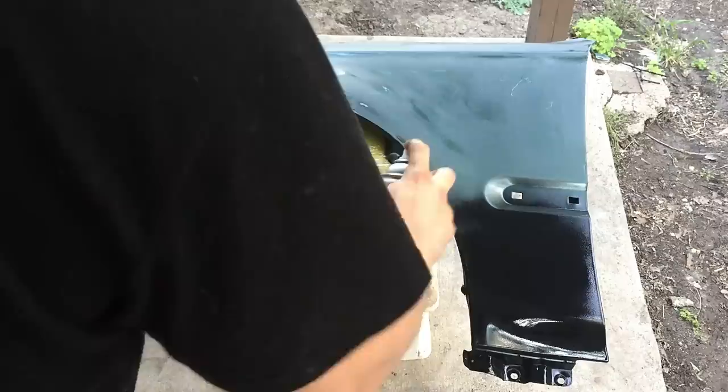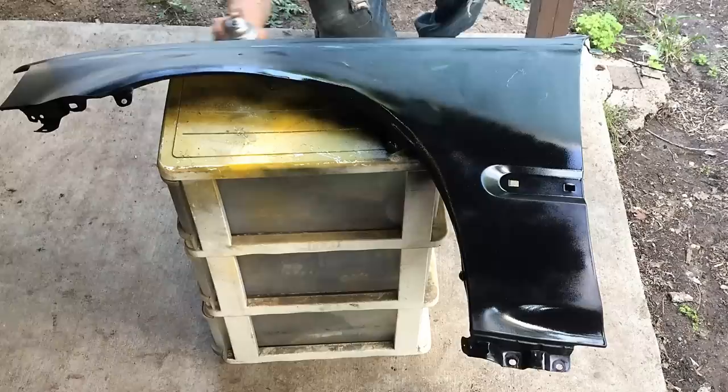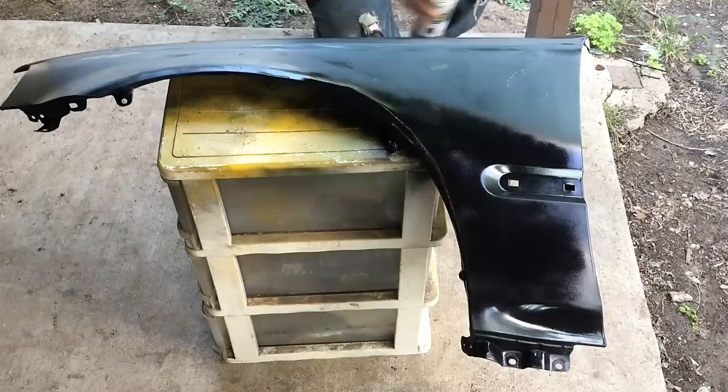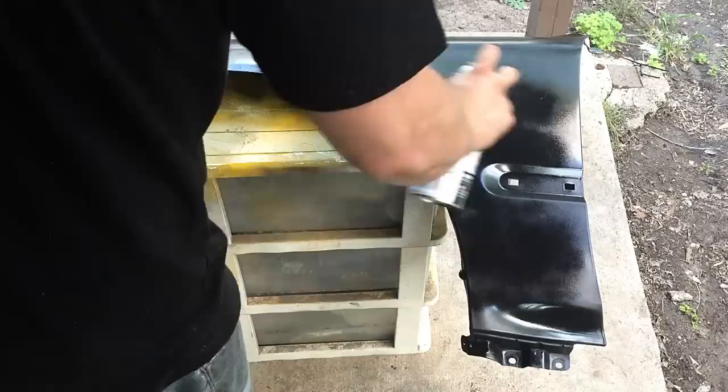This is the sweeping motion I do on my first coat — I lay it kind of lighter. You're not gonna want it to look absolutely perfect on your first coat unless that's what you're going for. It will run very easily if you lay it on thick. I've been doing this since I was 16 years old on vehicles — before that it was bicycles. I'm 29 years old now, so I have a lot of years of experience and I know how to lay it without getting runs.